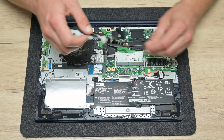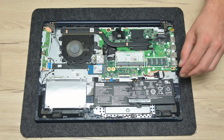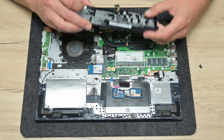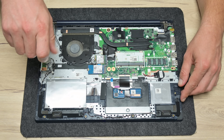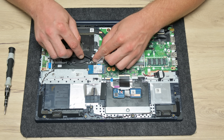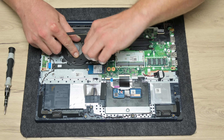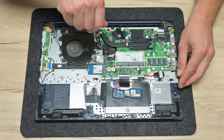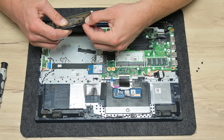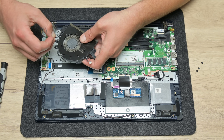This is on a very micro level that is almost impossible to detect using tools or anything else. But in cases like this one, I always try to disconnect and reconnect the cables, checking the pins and the contacts. This type of problem is rare, but it's happening. Usually the laptop won't show any signs like a blue screen or anything — Device Manager will look fine, even installing the drivers will be fine. But actually something very tiny is out of place. The laptop from the inside is looking great — the motherboard has never been removed, never repaired. Maybe the thermal paste has been changed and the cooling fan cleaned, but in general this laptop is in super great shape.